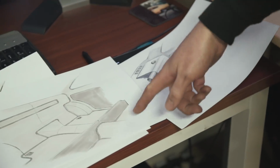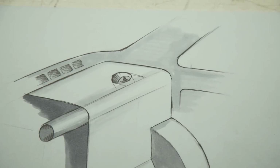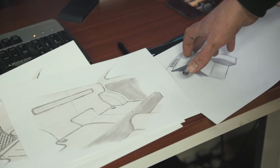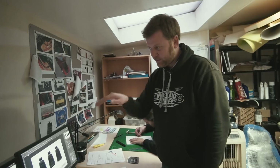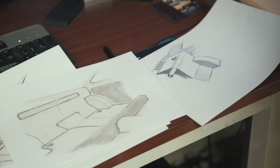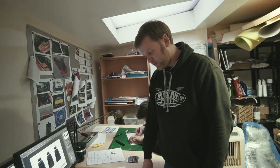We're going to do a structural tubular cross member in the back there, which actually ties into the inner quarters and the arch tubs and the turrets. So that will stiffen the shell up a lot, but also then allow us to upholster straight forward and round and down that to give a nice radiused corner on that back panel. And then there'll be access panels in the top there which allow you to get to the damper adjusters on the top of the struts in the back, which we might make a feature of. I'm not sure yet on that one.